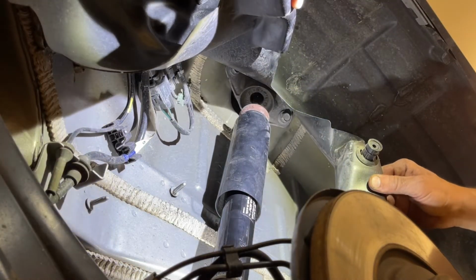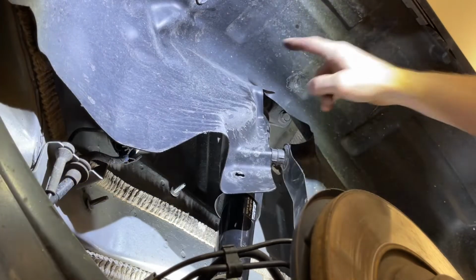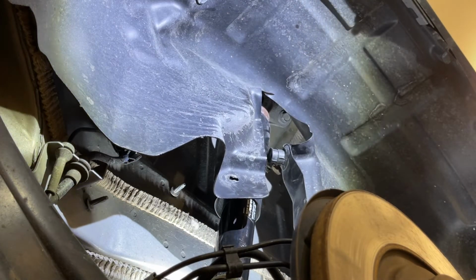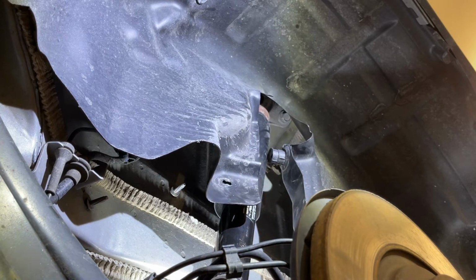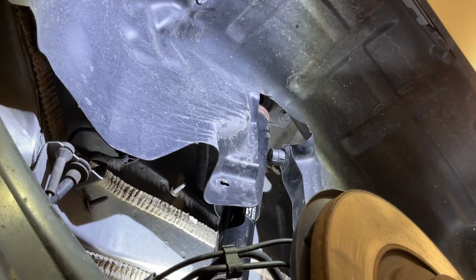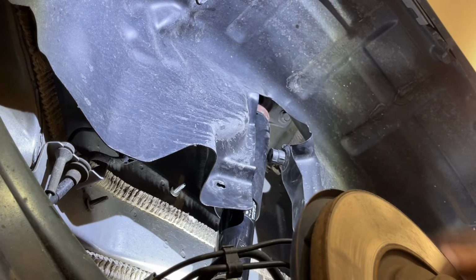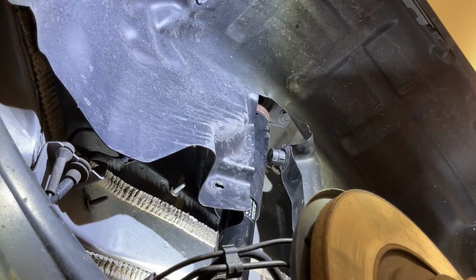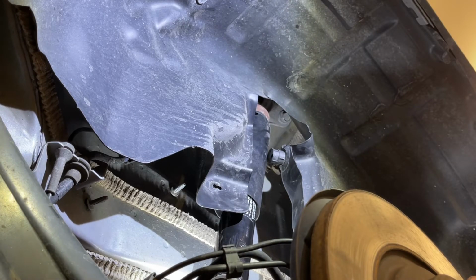And so now we're to the point where we want to torque all three of these bolts down, the two uppers and the lower. The torque spec for the uppers is 37 foot-pounds. And in some cases with suspension, you want to get the vehicle at ride height before tightening them down. The geometry of this one will not change much for all of these bolts. Really isn't going to change much when we set the vehicle down, maybe a degree or two, but certainly not like some control arms and things like that. So I'm not concerned about it in this application.